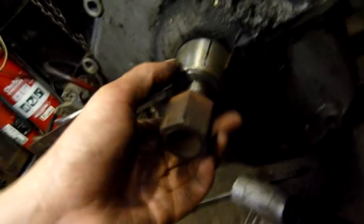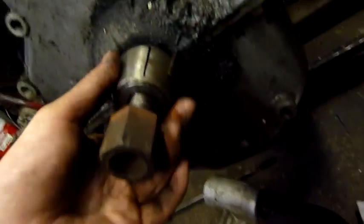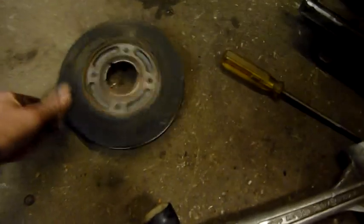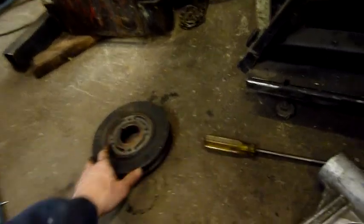I'm not keen to beat someone over the head with a camshaft, even though it looks like you'd probably do a good job with that. It's about two feet long. Bashing it with a hammer didn't do anything, but as soon as I loaded up with the puller here, it went pop. That's a taper-locked harmonic balancer. I had a feeling it was, as soon as I saw these notches - the splits in the inner bushing - that's a giveaway that there's a tapered bushing in there. The balancer is very badly degraded, watching it run it doesn't even run true - it's off centre. So that's junk.